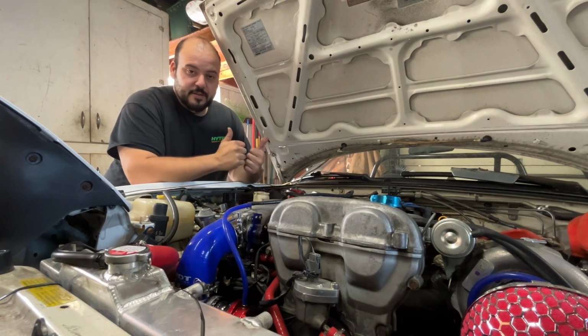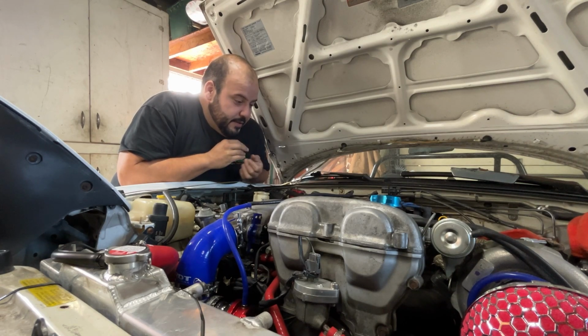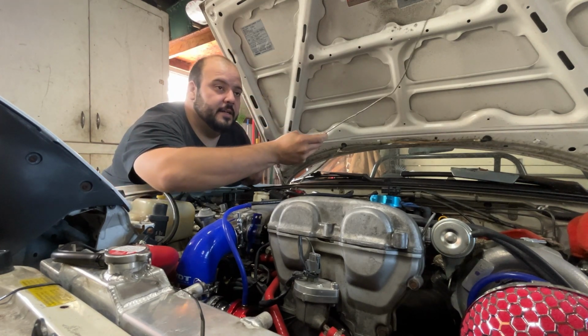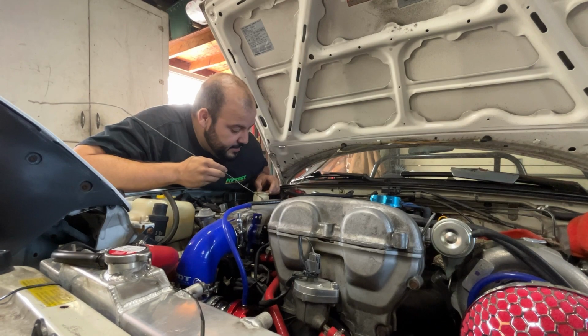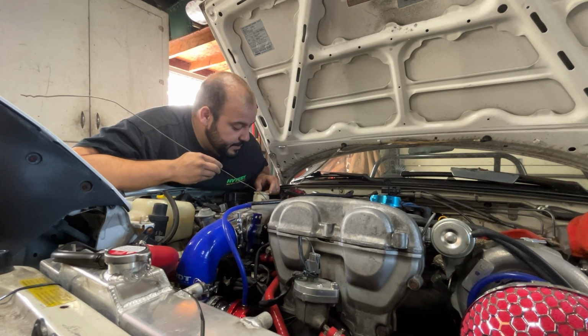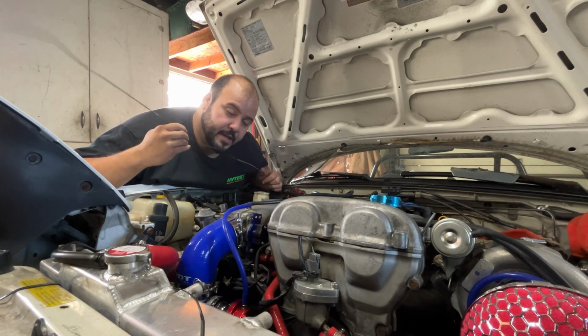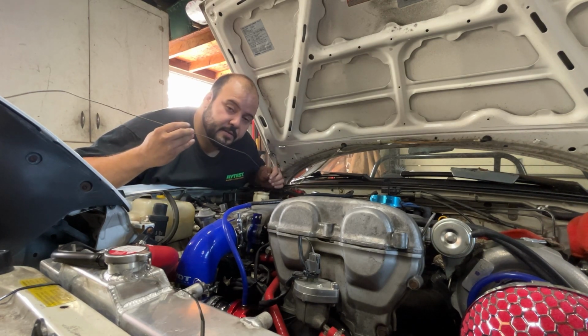Hello, YouTube. Chris here. About to get this O2 sensor hooked up, and we're gonna hook it up to the air fuel ratio gauge that we have to mount up inside the car. First, we're gonna get this wire hanger through the firewall here, through a little hole that the AC unit piping was going through the firewall. We'll run this hanger wire down there until it gets on the inside underneath the dash, and that way we can tape the wires to either side and pull them through.